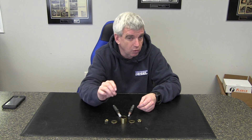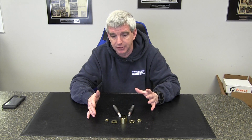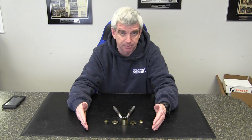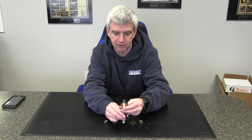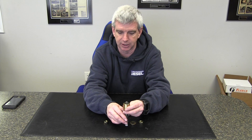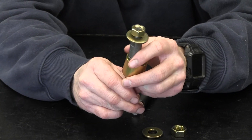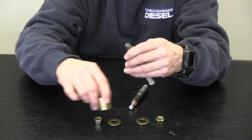It's going to keep the injectors in good working condition. So if you're just planning on changing out the nozzles, you're probably going to have the injectors out a couple of times inside of the truck. This is going to keep your cores in good shape where you're not tearing anything up. It comes with both setups to do both of the different year ranges for the VE pump trucks and your P7100 trucks. This sits down over top of the injectors — we'll use a VE style. You have this hardened steel washer that goes right over top of the injector line, then use the hardened steel nut that comes with it, and that is going to put pressure on it. You just screw it down and it'll pop the injector right out of the bore, keeping the injector in good shape without tearing it up.